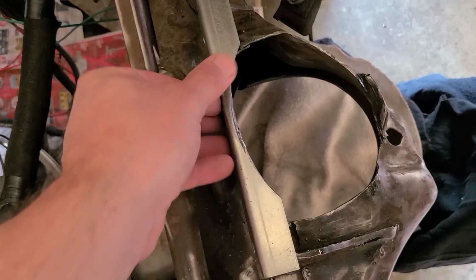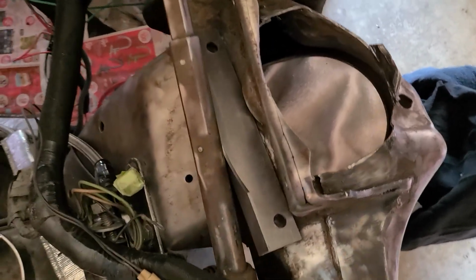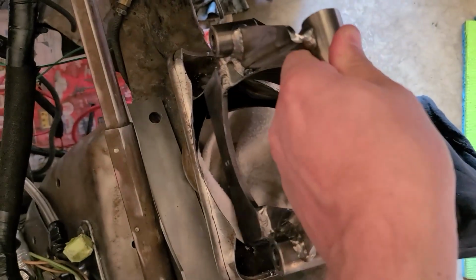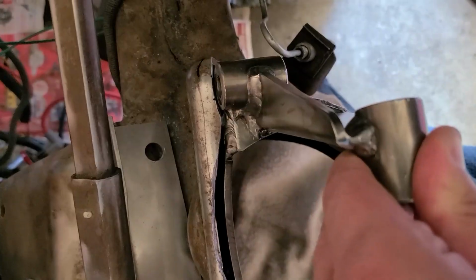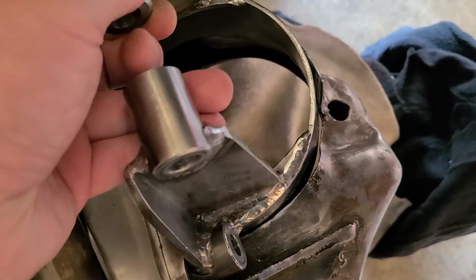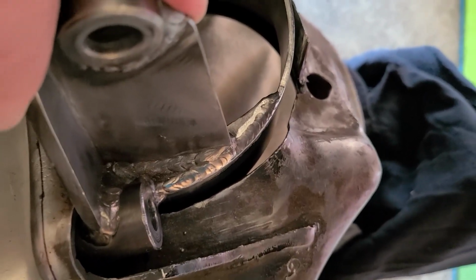All right, this template that is provided, it's a piece of crap. They tell you to bolt it on, draw a line, and cut out the frame like so. The problem is, when you go to put in your bracket, these dowels right here hit it, on both sides. It becomes a problem. So you end up cutting open your frame a lot just to get them in place. And then when you bolt your bracket in, look at the gaps that you'll have.